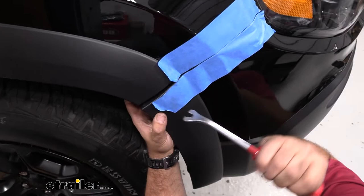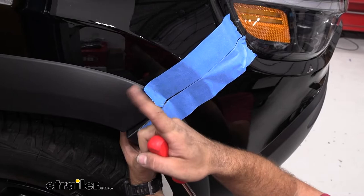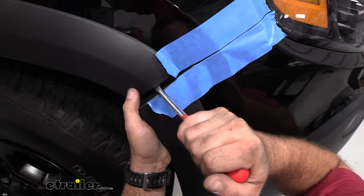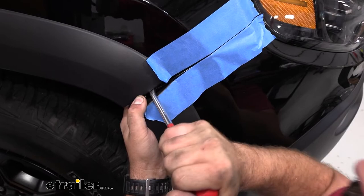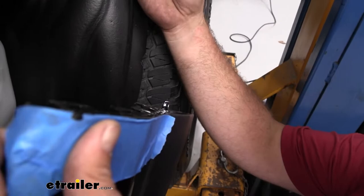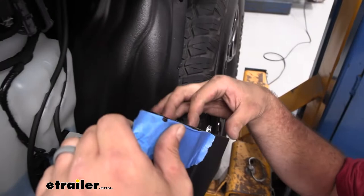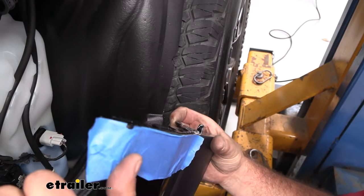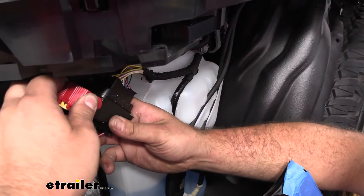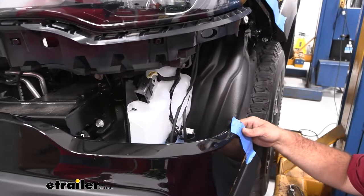To separate the fascia from the front fender, there's a tab that goes straight up, so pry down and pull back to pop the clips out. This can be a little tricky — there's a tab that bites in, requiring a downward motion and then pulling out. Work carefully with the plastic clips. Once this side is off, the rest unsnaps along the seam pretty easily. With the fascia loose, unclip the yellow locking tab on the electrical connector and slide it out to separate. Get the other side with your extra set of hands and set the fascia aside safely.